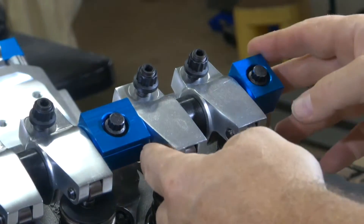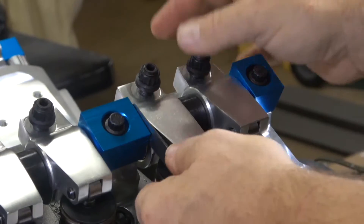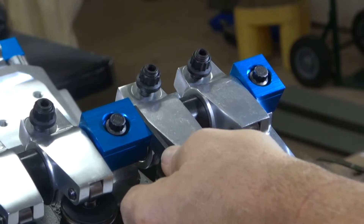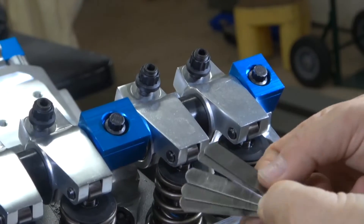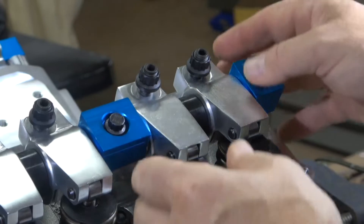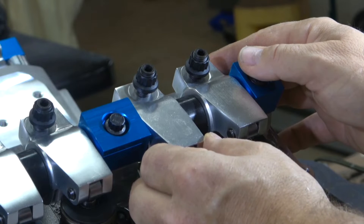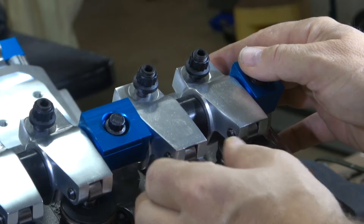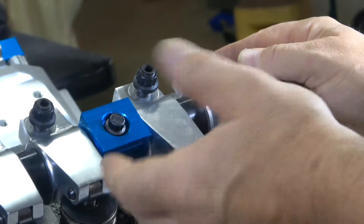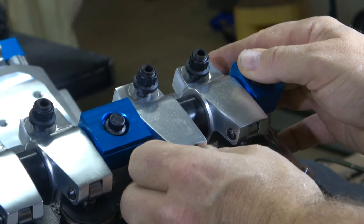What I can do is push them all to one side and take a measurement. I simply measure how much total gap I have with my feeler gauges — and I have, totaling them all up, 115 thousandths. Now each one of these rockers is supposed to have between 15 and 30 thousandths of end play. 15 to 30 means you need 30 to 60 total. So let's shoot for an even number — let's make it 40. It's supposed to be 30 to 60, so let's go on the low end and go for 40.